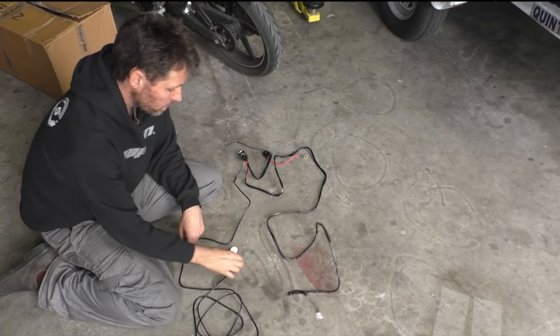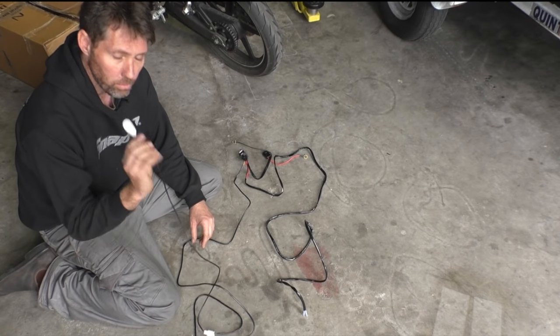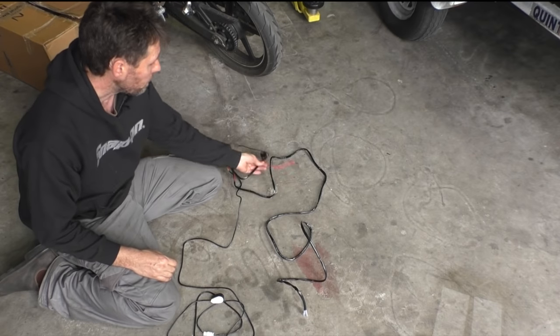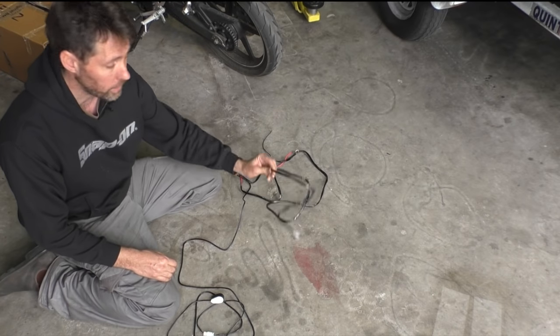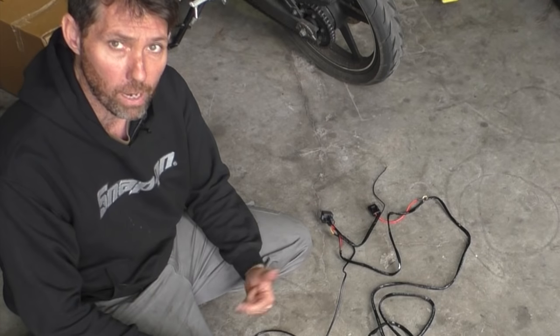What I'm looking to do is copy this exact design — nothing wrong with the circuit itself. I'll put a waterproof switch where this one goes, probably reuse this relay and relay holder for now, swap in a waterproof fuse holder, and then use some marine cable. So I'll show you where I'm going to put them on the boat and how I'm thinking of running the cable.